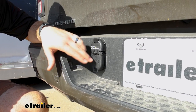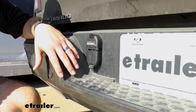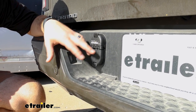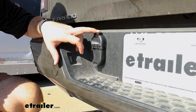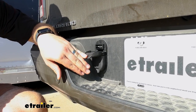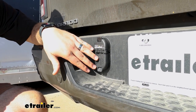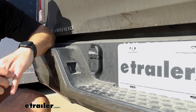Adding a 4 and 7 pole wiring harness to the back of your Colorado is going to allow you to pull any type of trailer out there on the market, as long as it doesn't have a 6 pole on it. If it has a 6 pole, you can get a 7 to 6 pole adapter to pull those trailers too. Your 4 pole is going to be here on the top, your 7 pole is going to be on the bottom, and it's going to be just like a factory plug as if you were to get the hitch and wiring from the manufacturer.